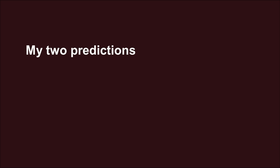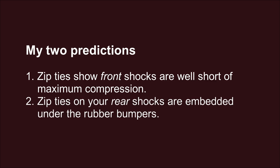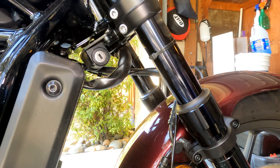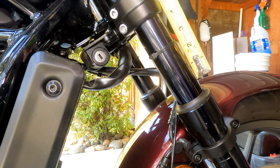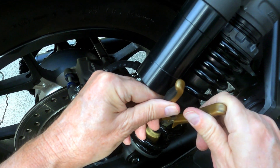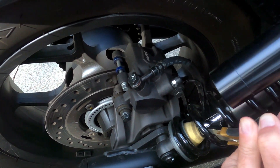I'll make two predictions based on my experience. One: the zip ties on your front shocks ended up well short of maximum compression. Two: unless you kickbox in the Bantamweight class, the zip ties on your rear shocks have become embedded in the rubber bumper at the bottom of the chrome shaft. When I performed this simple test on my Rebel 1100, the front shock tubes pushed up the zip ties three and a half inches, comfortably short of the 4.8-inch maximum compression. However, the rear shock bodies pushed the zip ties inside the rubber bumpers.